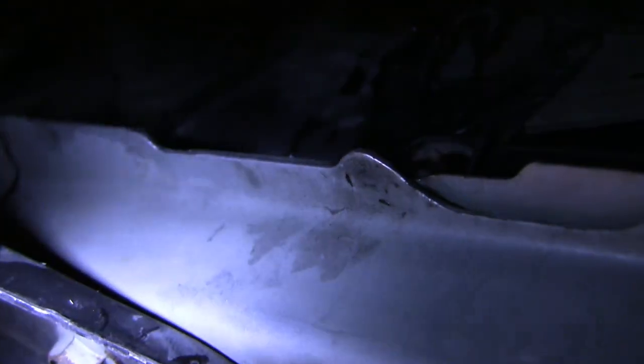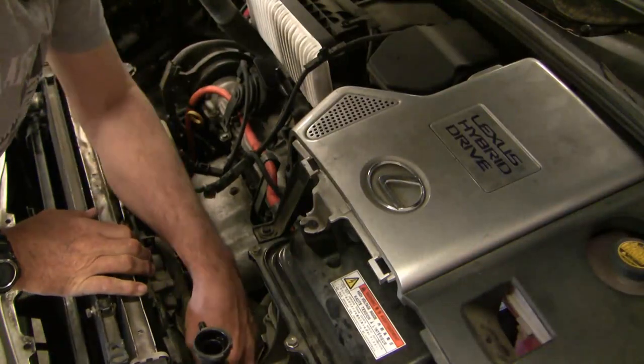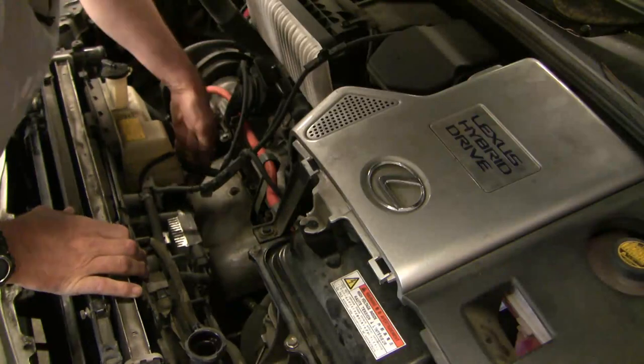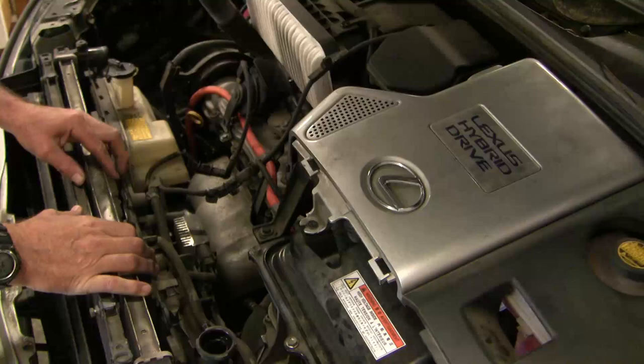This is under the vehicle looking forward. There are two tricky fan shroud bolts you've got to get off — the left one's right there. The next step is to remove the wiring harness. It's right here, and there's no easy snap on the outside of it, so we're going to have to undo the connectors here and down there, take off all these plastic points, and pull the wiring harness right away.